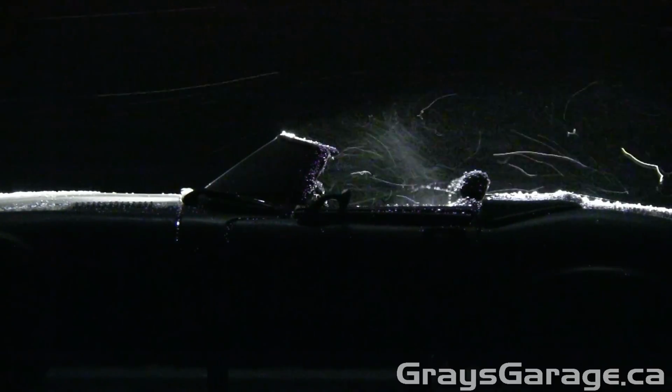But it's very unsteady, which means that it's changing very rapidly in time. And again, this is what really causes that driver fatigue. It really causes the annoyance. And this is one of the features here of this E-type Jag. So we're going to see now what the difference is when we close the top and we have the two-seater coupe with the hardtop, how the flow moves around this region, even with this very sharp windshield angle.